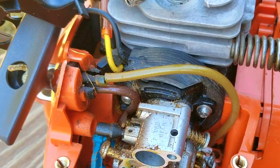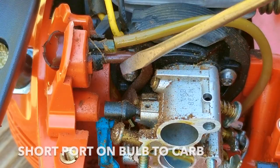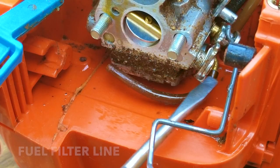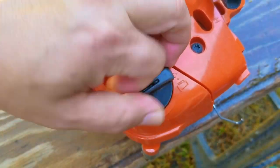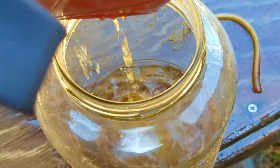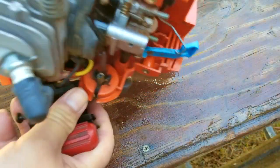Before doing anything else, I want to look at how the lines are routed and figure out how bad the damage really is. The longer port on the bulb connects to a fuel line that goes to the tank on the right side. The short port connects to a port on the left side of the carb. The last fuel line runs from a port on the lower right side of the carb across the bottom into the left side of the tank — and that one is also broken. Even if you didn't know the purpose of each line, looking at them before removing them helps figure out the routing. If they were too badly damaged to trace, check online for a video like this one.